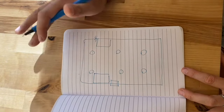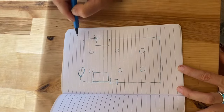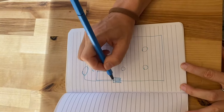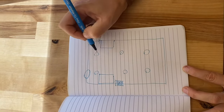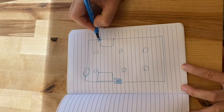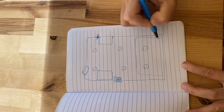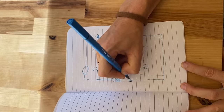I'm going to show you a quick demonstration before we show you how we wire it. This is our van — driver's side at the front, our kitchen cabinet, our stovetop cabinet, and then the back of the van. Here's where our fuse box is going to go. It's really important that you map out where all your connections are going to end. We're actually going to run two separate systems: four main cabin lights off a switch next to the side door so you can turn them on as you get in, and two puck lights over just the bed area as a dim nighttime vibe, with a switch near the bed.